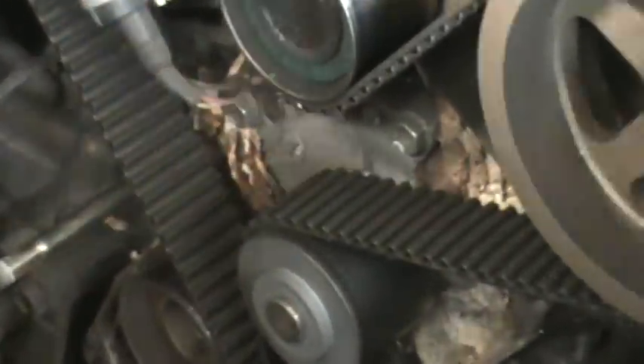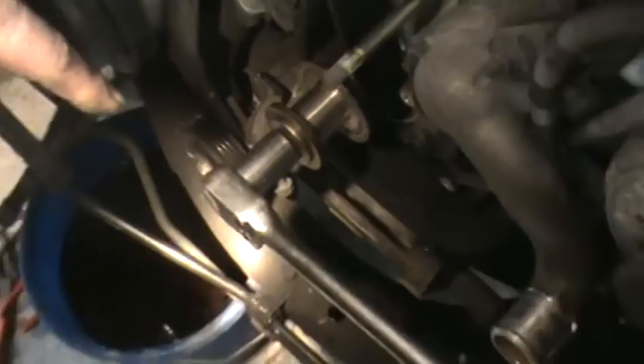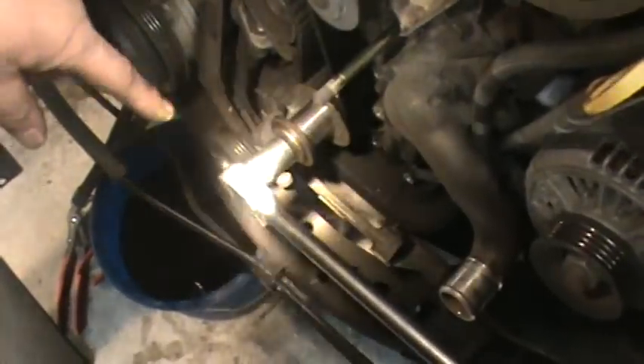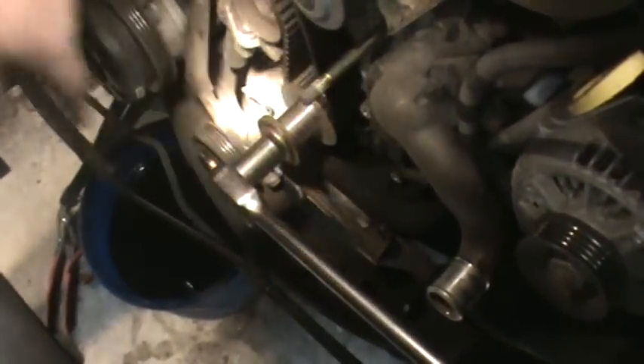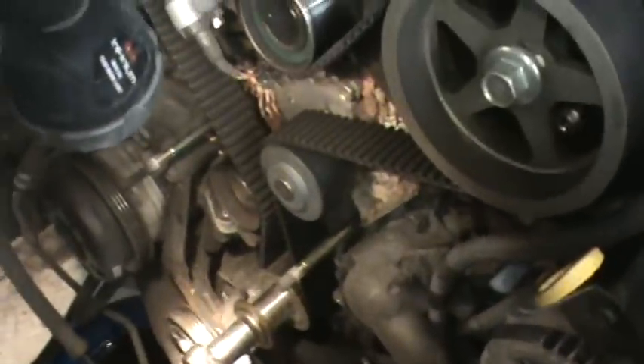What we found, other than all this leaking going on and corrosion under here — I lined up the timing belt. The crankshaft is tough; you've got to use a half-inch impact on it and it came right off. I couldn't find my 19 stubby, so I used a three-quarter stubby and it worked just as good, took it right off. Then the crankshaft pulley, or the harmonic balancer, just comes right off.